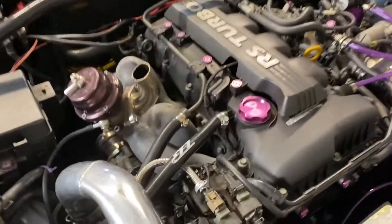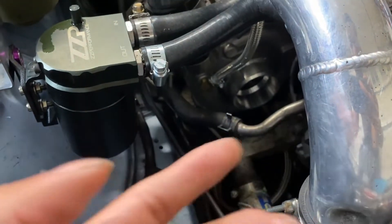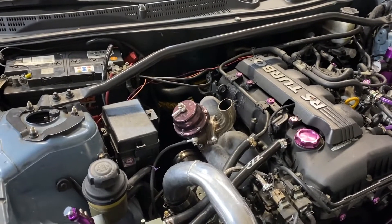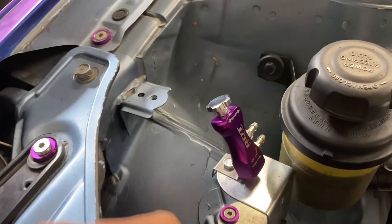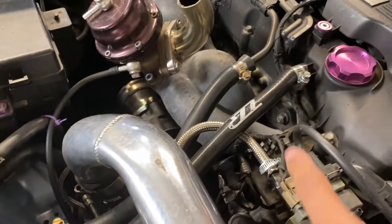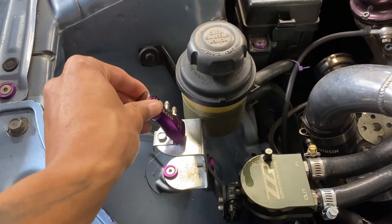I also did a steel braided boost hose — this goes from the top of the turbo to the boost solenoid. I was kind of sick and tired of using the rubber one because I was afraid of it melting — I did have two others melt on me before. So I went ahead and changed it out with a steel braided one. I also temporarily put my stubby up pipe from the wastegate on because the unicorn one started looking kind of dumb after a while. Got the boost gauge and manual boost controller installed — I made a custom bracket for it. This oil catch can is actually from a CTS-V that I custom fit to my vehicle, and I also made my own custom brackets mounted to the chassis.